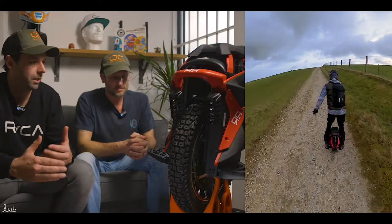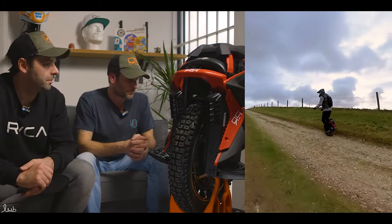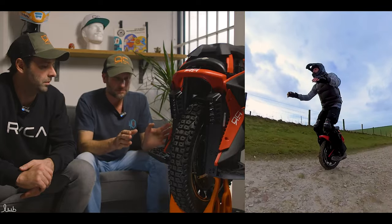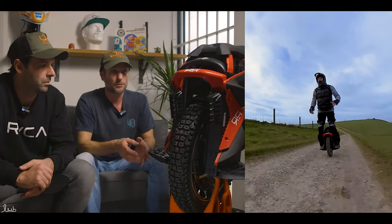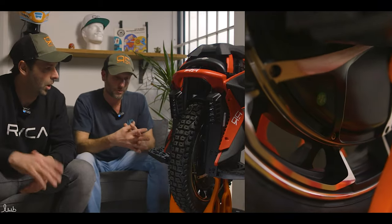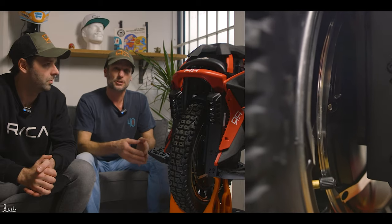They were looking to make an off-road mountain bike-inspired wheel. From the big chunky off-road tire you can see that, and that huge amount of power in the motor is going to be great for getting you up and down those hills. For an off-road wheel it needs to have really good control over the torque curve, because the torque curve translates into traction. When you're off-road on rolling pebbles, stone, mud, you need really good control over that torque curve — it's critical.